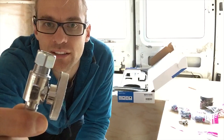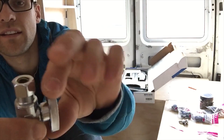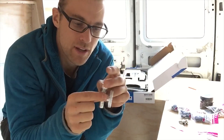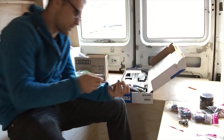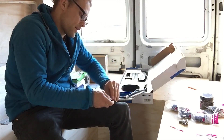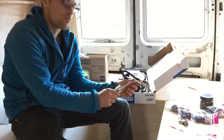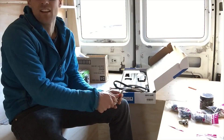This one here is called a straight stop valve — as you can see it's got a ball valve inside that turns on and off. The purpose of this one is to fix into the plumbing below and then the faucet hoses poke into the top and screw on. These come with their own locking nut but the faucet ones will also lock on here. So that allows me to run my plumbing just up the back walls of the sink, leave them there clamped in position, and then when the sink's installed I can drop the faucet down and screw these in from the top. That also allows me to turn these on and off if there was ever a problem.